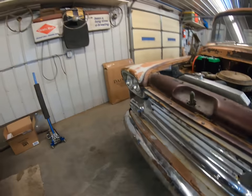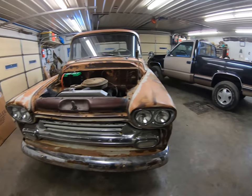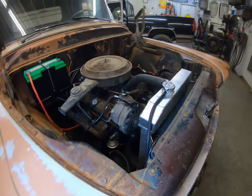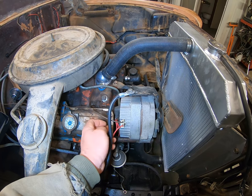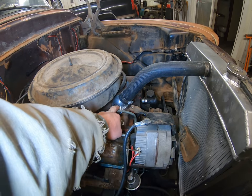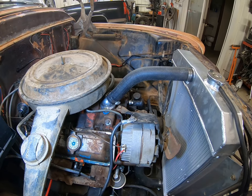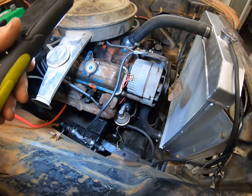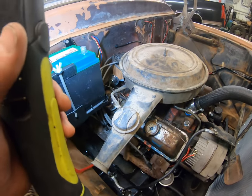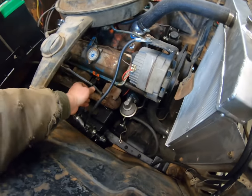The LMC wire harness is actually really good but they had some wires mixed up so the low beams would be on slightly when the high beams were on. We figured out they had a couple of wires flipped around after they sent us a second wire harness. Stock GM alternator — wired it up to the ignition so that it energizes, just did the quick shortcut way. I did have to get a straight water neck — the '77 one is angled out to the side. I like using factory hoses and factory stuff so you can get parts at a store on a Saturday, and I just hate flex hoses — they're cheesy and ugly. We did put a new thermostat, vacuum advance, plugs, wires, cap, rotor — all that good stuff. The Quadrajet probably could use a rebuild but it actually seems like it runs okay.